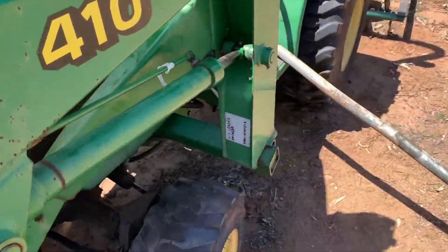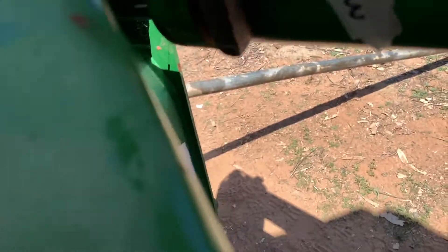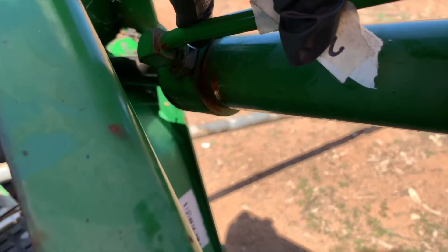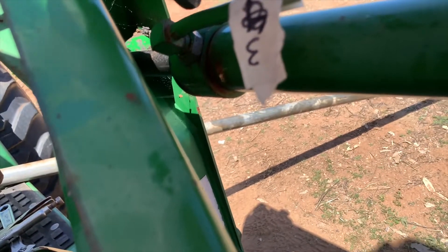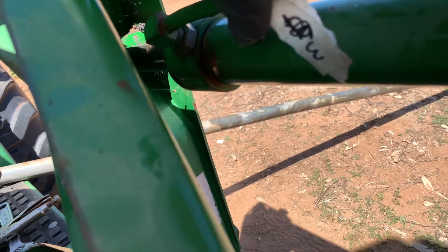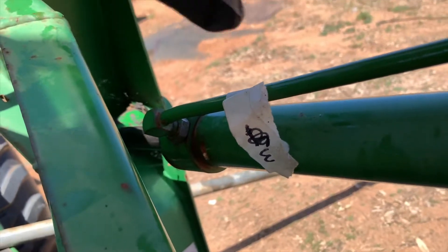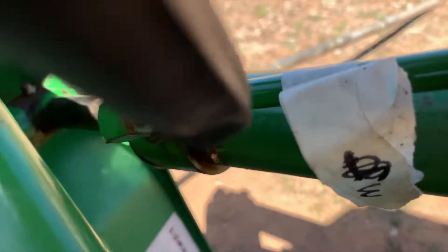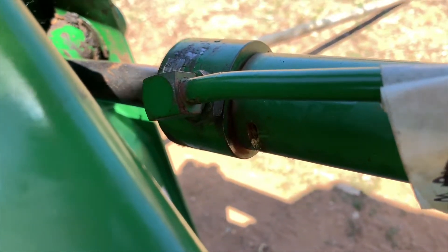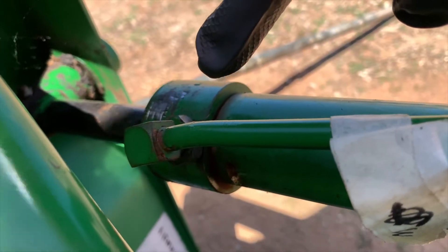As I suspected, I turned this gland here but the wire inside is so rusted out that it did not twist out as it should have from that slot right there. So from this point things get a little messy. You're going to have to put some WD-40 in there to really loosen it up so that that wire is not tied in there. You're pretty much loosening up the wire, throwing in some WD-40, twisting this back and forth in order to loosen up that wire inside. I'm doing a back and forth motion with this gland right here in order to loosen up the wire inside.